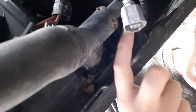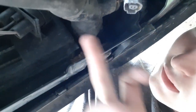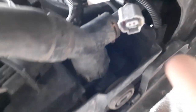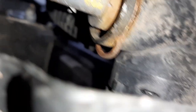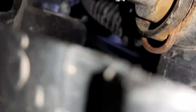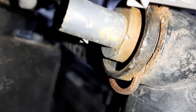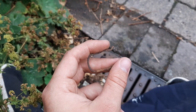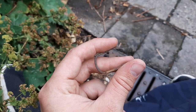There's a metal clip — it's a bit blurred but you can see what I mean — which holds the sensor in a little elbow at the end of the radiator going into the coolant pipe. To remove it, if we can get a flathead screwdriver just under there it should just yank out. It will be a little bit rusty, but that's the only thing holding the sensor in. That clip is out now — literally just dug at it with the screwdriver for a minute and it came out no problem.